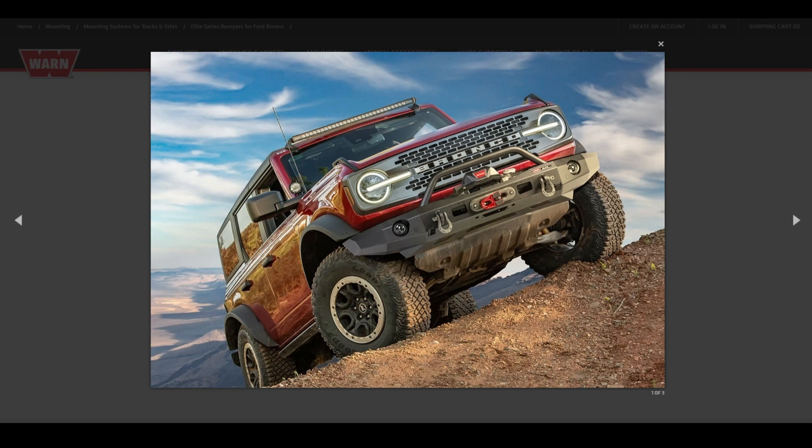The Bronco's forward-facing camera is going to be blocked by the grill guard tube, as it has an upright mounted winch control box. However, buyers can retain the camera functionality if they select the Elite bumper without the grill guard tube and relocate the winch control pack from the top. The control box relocation hardware is available as well.